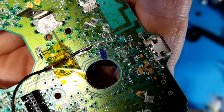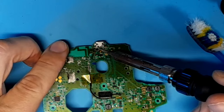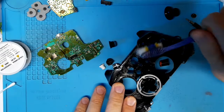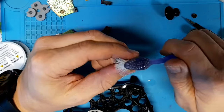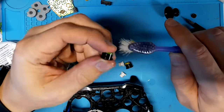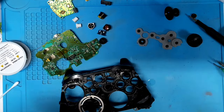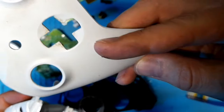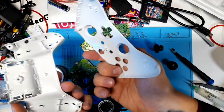Moving on to that connection issue. The USB port looks pretty good and doesn't look damaged in any way, so I'm going to clean it using a toothbrush and some isopropyl alcohol, and then reflow each of the pins using a little bit of flux and heat from my soldering iron. When it comes to plastics, I use 70% isopropyl alcohol and clean them up as best as I can. I cleaned all the buttons because there were goobers attached to the sides — not sure if that was causing issues, but if they kept building up they eventually would. This conductive pad is responsible for button presses, and you can find it in every single controller, all the way from Series X to the NES. If you ever have a controller where a button's not working, clean this thing. The exterior shell is free from any electronics or metal, so I just cleaned them with soap and water and a toothbrush, and they turned out great — almost looking brand new, which is exactly what I'm aiming for.